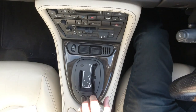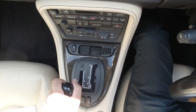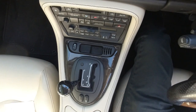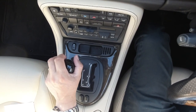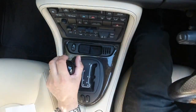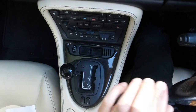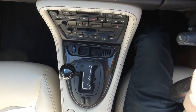This is a very clever gearbox with a lot of features and modes, but they're hidden behind the clean interface we know as the J-gate — what looks like a manual transmission stick in a J-shaped slot — and a single sport button we can press with a finger, plus the kickdown button beneath the throttle pedal. Combined with the car's other sensors, it manages all these modes to give the best driving experience.